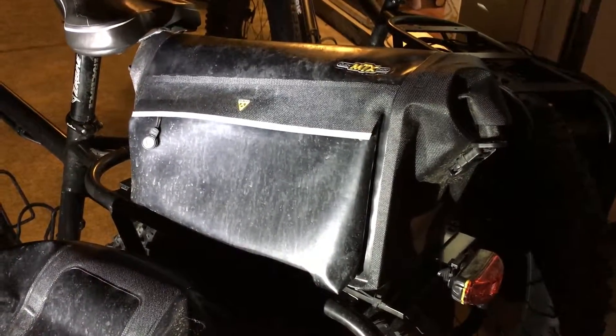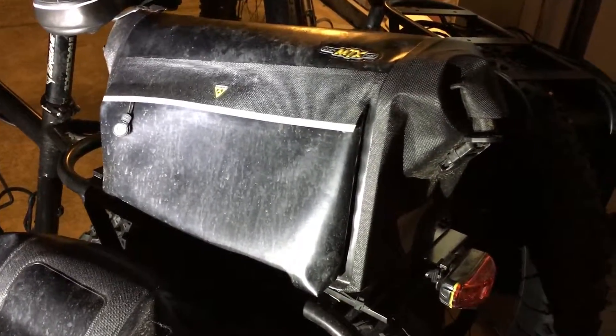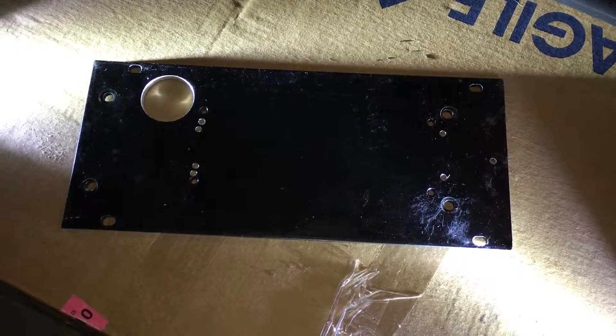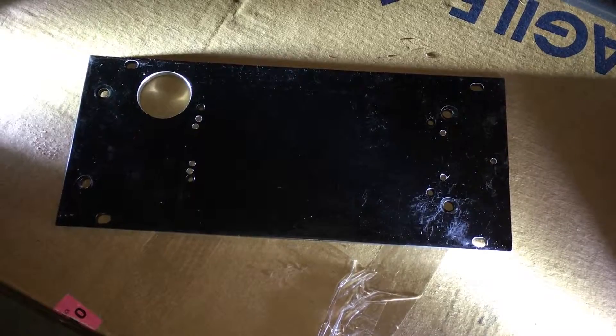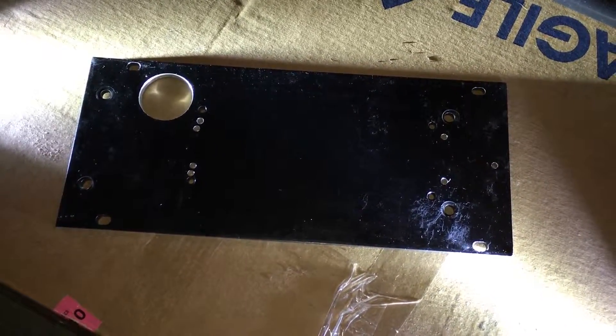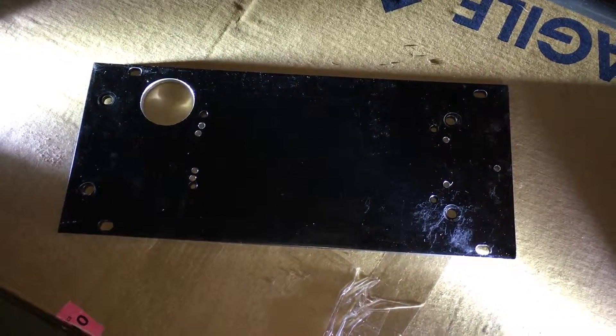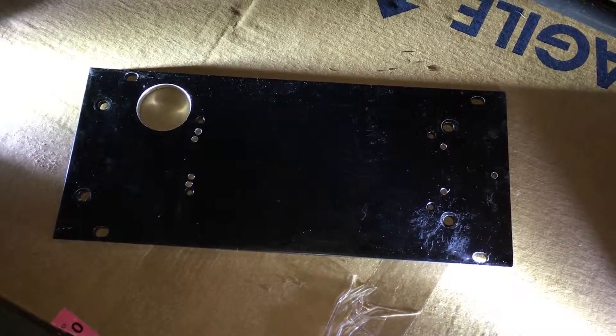As far as finishing the heat sink, the best thing to do is use jet hot coating — the material they use to coat mufflers, which is designed to transfer heat away. I powder coated this one matte black to match my bike.